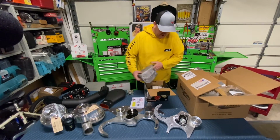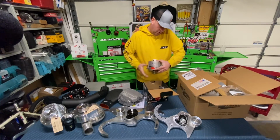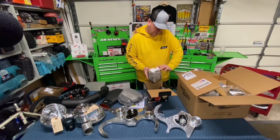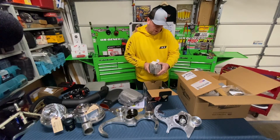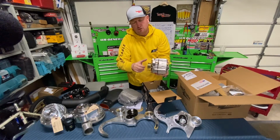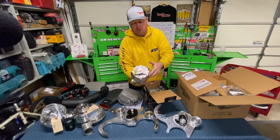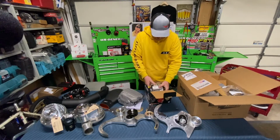All right, and this piece is a standard high amp alternator. It comes with a birth card right here. You can see at idle, it's calling out for 103 amps. At cruise, 128. And on the top end, it's rated at 153. So these are some pretty nice alternators. It's got the cooling fins on it, and it's set up for the 6-rib serpentine already. So that's a nice alternator from PowerMaster. I'll throw that thing back in the box.